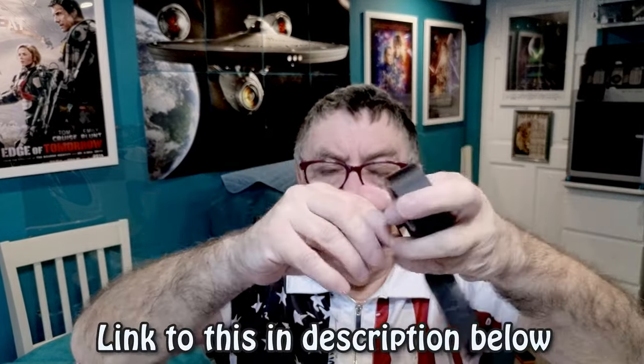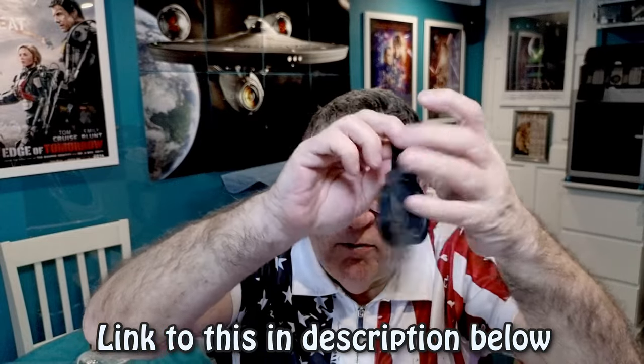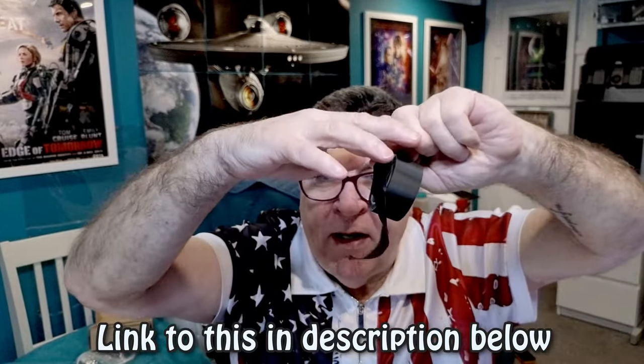It's dead handy for various household and projects in your car, like replacing a burst radiator hose and that. It's like a stretchy rubber. There's no adhesive on it, but when you wrap it round onto itself and hold it, just the heat of your hand, and it sticks together like a solid piece of rubber. So I use that because it's quite sticky, and I kept it clear. You can see there's a cutaway bit there and a cutaway bit there.